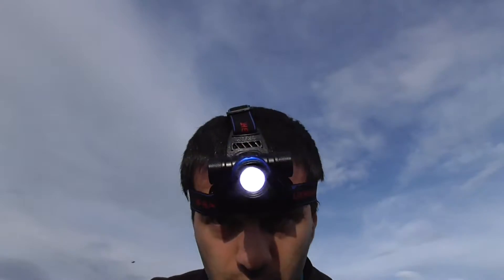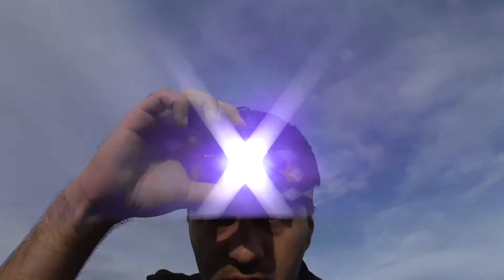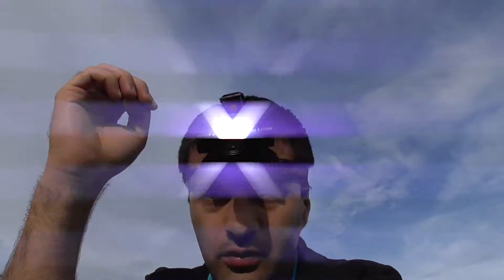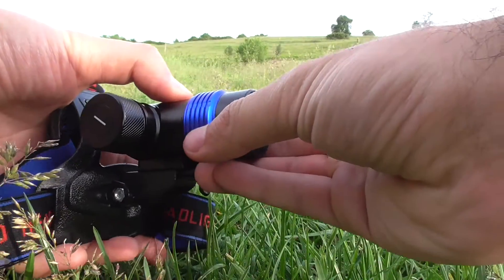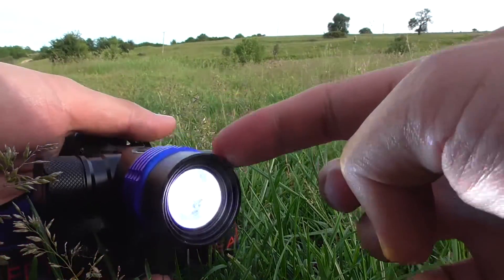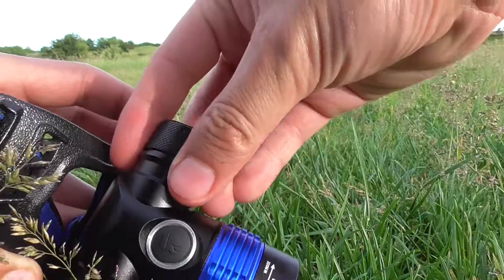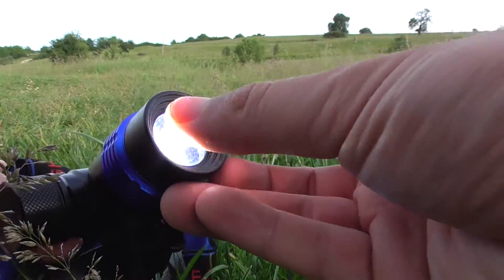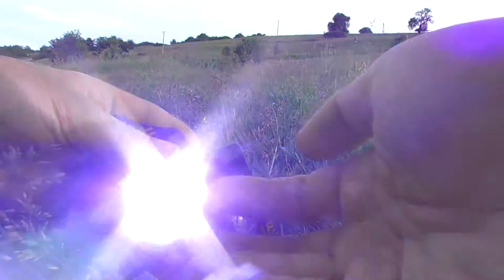That's the high beam, that's the low beam. On the monitor you can see stripes, meaning the light is being dimmed by pulse-width modulation. That's the stroboscopic effect, and off. The low beam is being pulsed quite rapidly, which is why you see vertical lines on video. Also, when the light is on the LED heats up, and the entire metal body — the blue part is metal, all around is metal except the rubber part — acts as a heat sink. So if the lamp gets warm or hot, don't be alarmed.